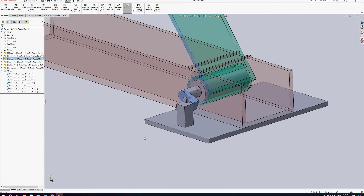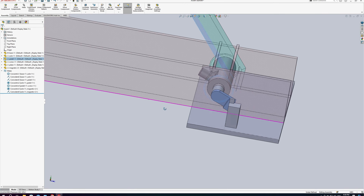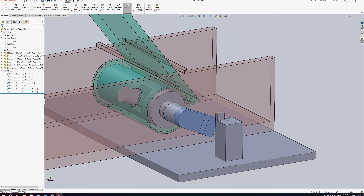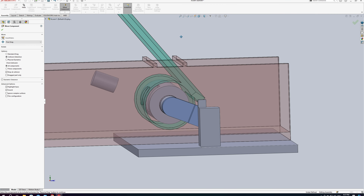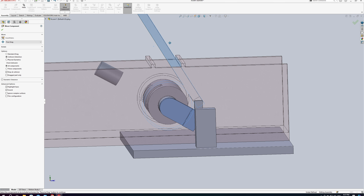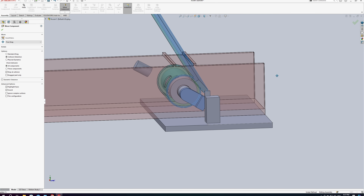This is why this pedal is super cheap — it's the cheapest pedal you can find on the market right now. Since it uses a hall sensor, you don't have to worry about wear and tear; it just works. I think it's a great design, but what keeps it from being a great pedal is the idle position — you can see the magnet is far from the hall effect sensor.